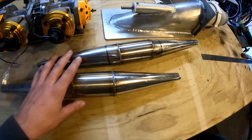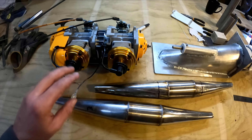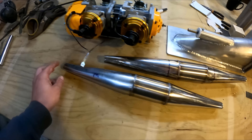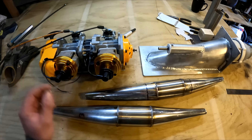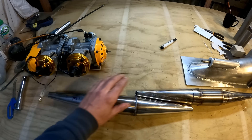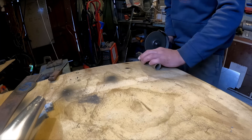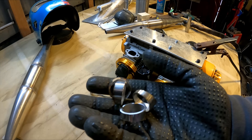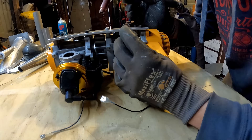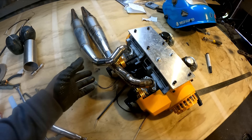There we go — that's welded off now. It was quite hard to weld because the sink sheet metal was only 0.9mm, though the other piece was a bit thicker. I've made a heap of pie cuts on these little bits of pipe and I've just got to tack them all together to make the pipe come out of the motor. After hundreds of cuts I'm pretty happy with how that is — I've got a lot of welding ahead of me.